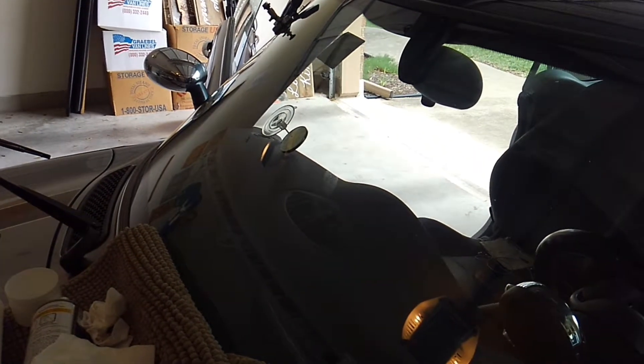The primary chip has been cured. Now we're going to use pit filler and put that right where we drilled, where the rock hit in the center — you can still see that spot. We're going to use a thicker, harder resin on the surface and then put the UV light on it to harden it.